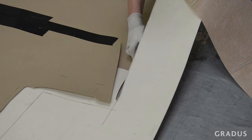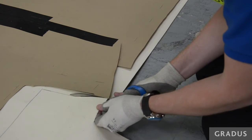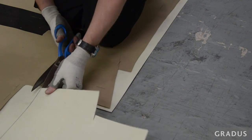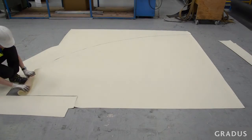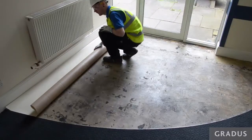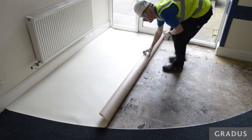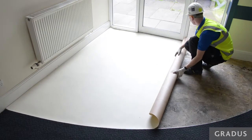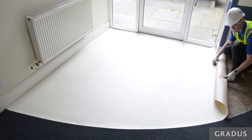Remove the paper felt and cut the excess vinyl around the perimeter. Then cut just inside the line so there is a 1mm tolerance, which will enable the mat to fit comfortably in the matwell. Place the template in the matwell and if necessary make adjustments to improve the size. The result should be a template sat flat and clear of any bulges or kinks, which is very important.